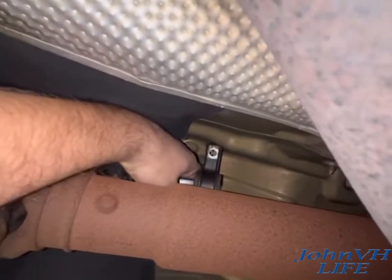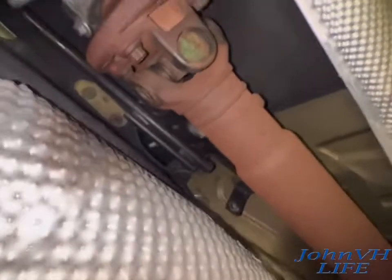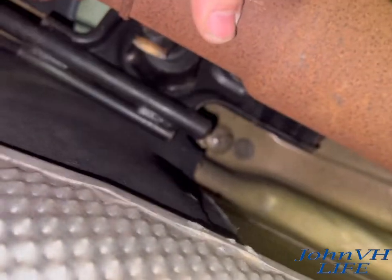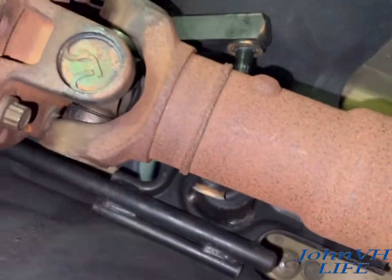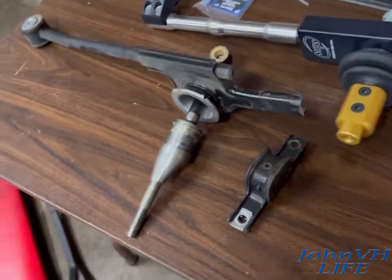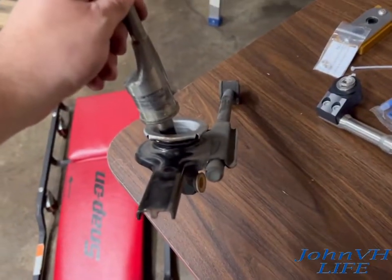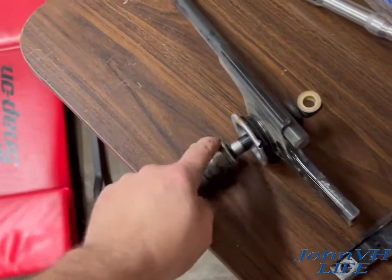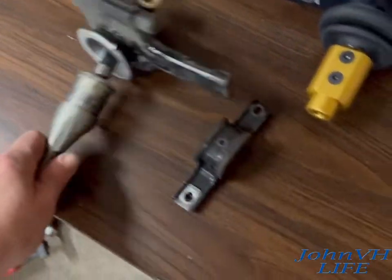Next step is taking this rear support off the back of the shifter. Once that's out we're going to go up top and try to squeak the shifter out — there's rubber pieces on there. I forgot one bolt here — there's one that goes through the shifter. There's a nut on the other side: pull it, take the nut off with the 13mm, and push the shifter linkage out to that side. Now we can take it out from the top — there's the stock shifter out.